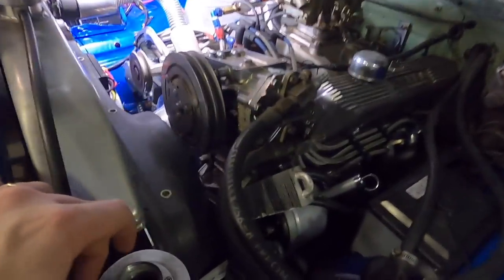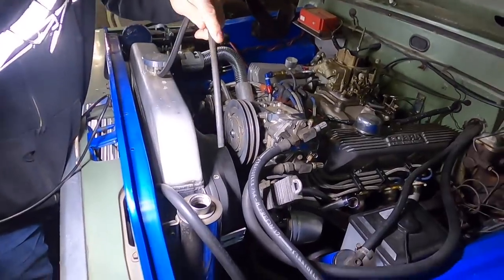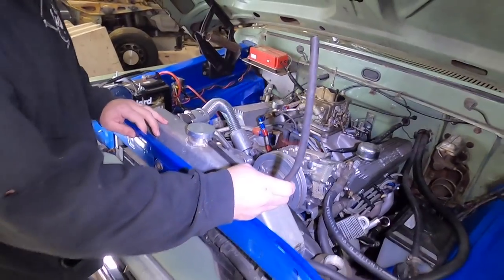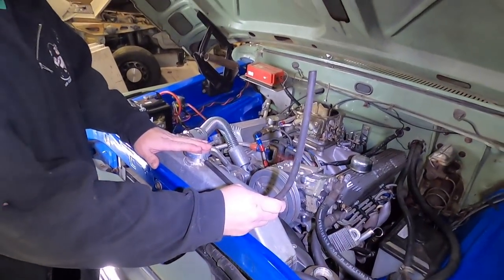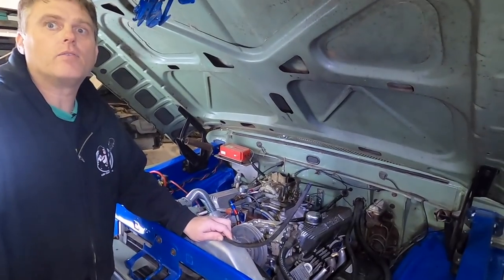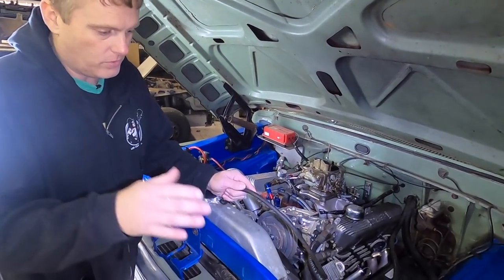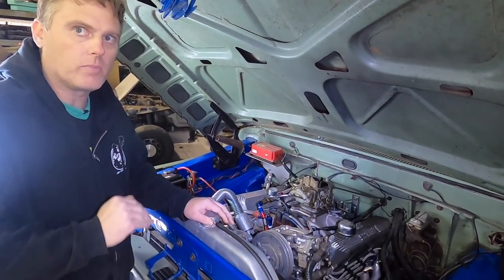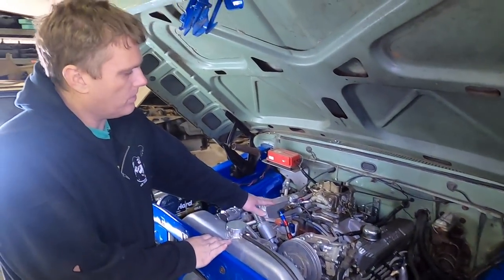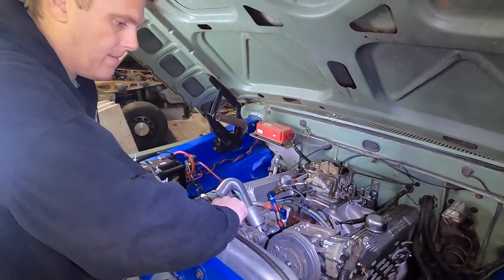I'm also missing an overflow cap and the overflow isn't even hooked up — it's empty. This should be hooked up to the bottom of that tank. What's happening now is whenever the cooling system purges, instead of going into the overflow bottle and being drawn back in when it cools down, it's just dumping coolant on the ground. So when the system tries to bring it back in, it's drawing in air instead. Your cooling level will gradually go down and you'll get air pockets in the system.